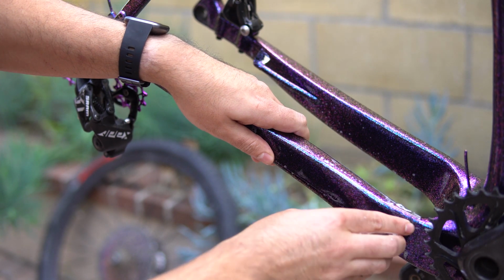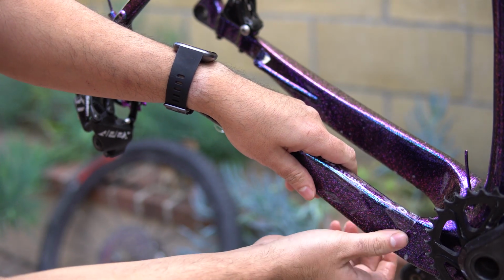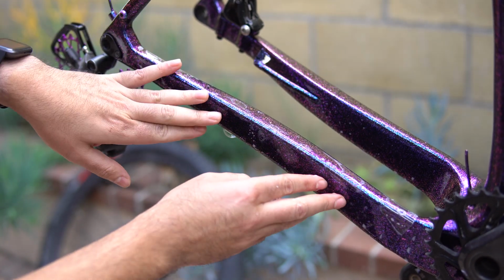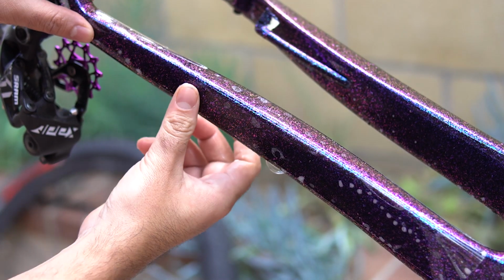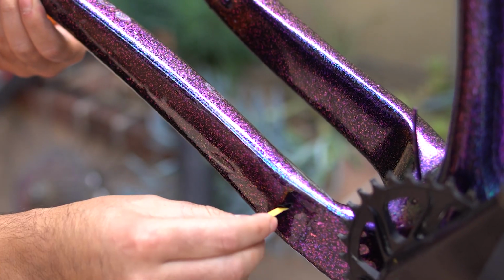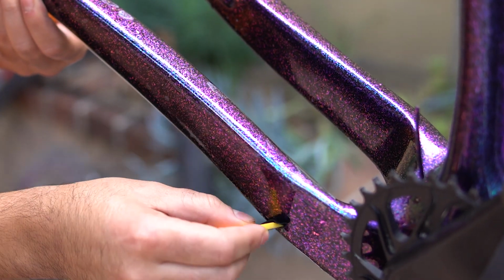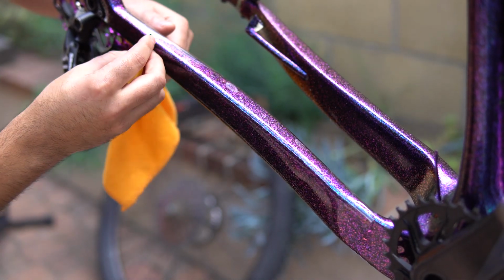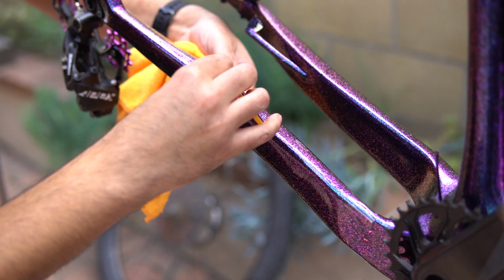Once you then apply the tape, you're going to slowly work out the air from one end to the other. Now I use a combination of the squeegee and my hands. I typically use a squeegee on all the flat surfaces since it makes it pretty easy. And then I'll use my fingers for any complex curves or the edges of things. Again, working very slow and methodically, holding down the tape so it doesn't slide around, because it's going to want to initially because it has nothing to really stick to.